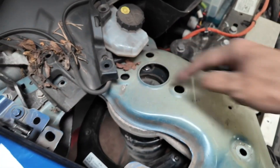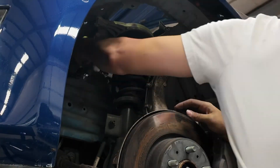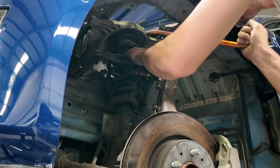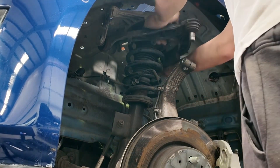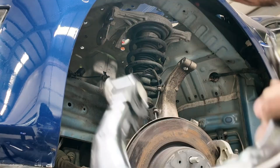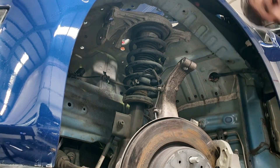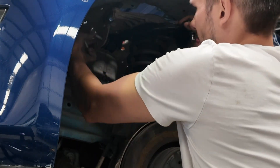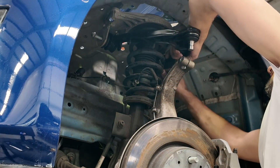Line this up with the four bolt holes and refit. Once the suspension has come all the way forward, you can remove the 15mm bolts at the back to remove the old suspension arm. This is the new part we're going to be fitting — it's brand new from Tesla. Leave the suspension out while you fit this, otherwise there's no access to torque the rear bolts. These rear two bolts you want to torque up to 50 newton meters.